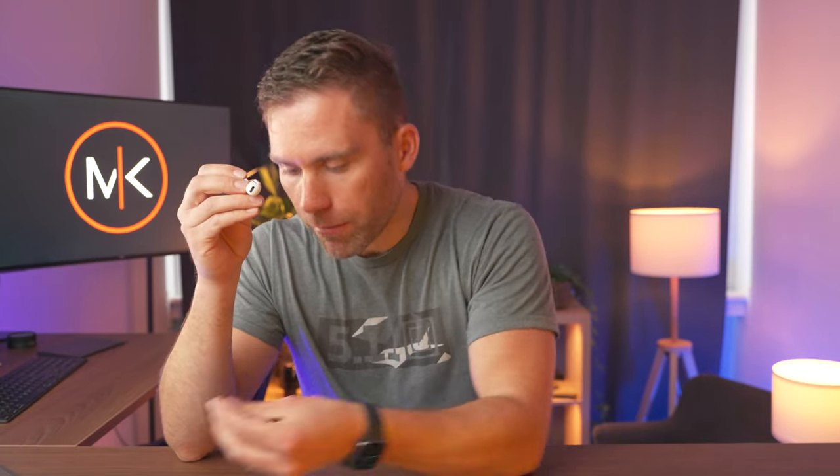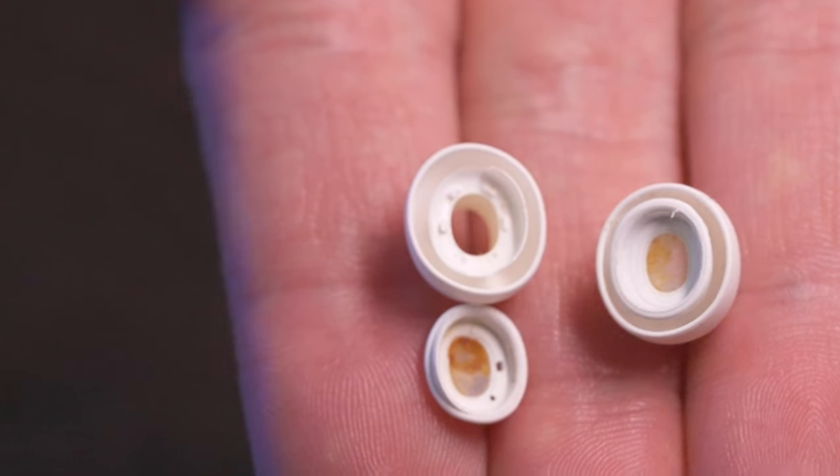If that happens, you just have to manually remove the piece. The inner part that came loose is the entire connector — it's a hole straight through. The other piece was attached here, so you can take your nail and pull it off, because it's supposed to look black. If it's not black, you didn't get the entire piece off. Then take your new oval ear tip, make sure it lines up, snap it on, and it's done.